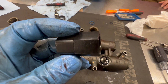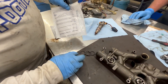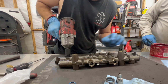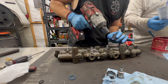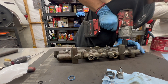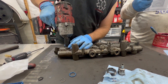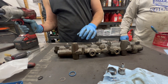We've got the HHC Diesel tool here - it takes it out and aligns the new cup up. We've got a new set of o-rings for this also, so we're going to bust all these out, put them in, and then re-torque them. The torque spec is 100 foot pounds.